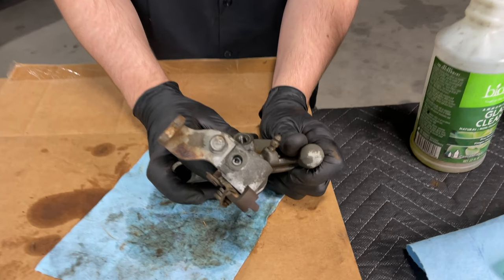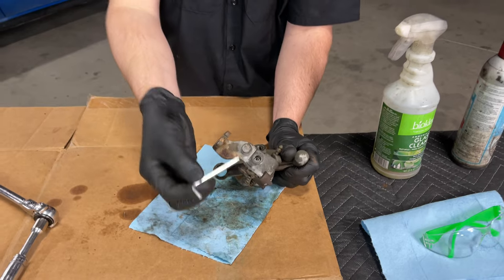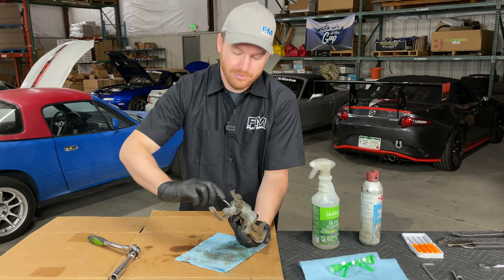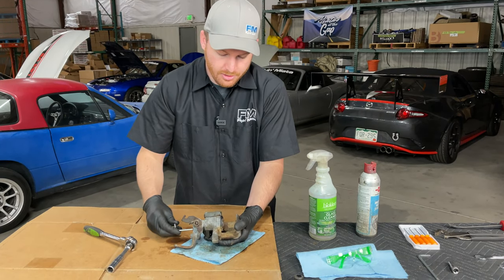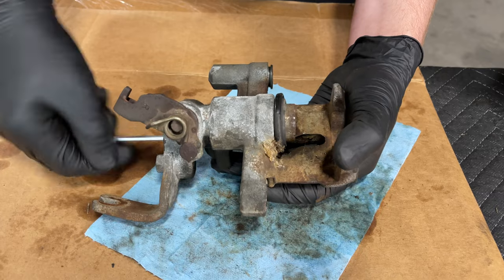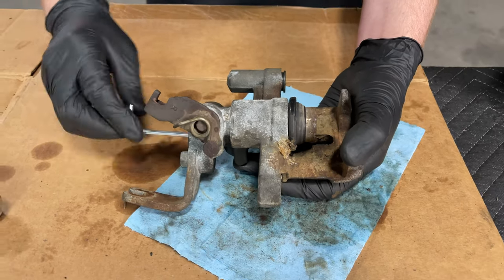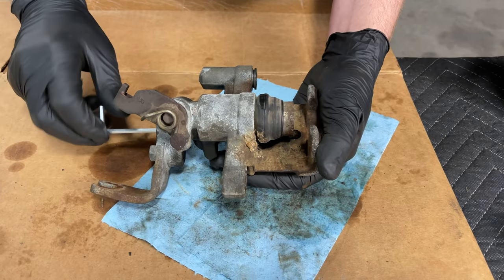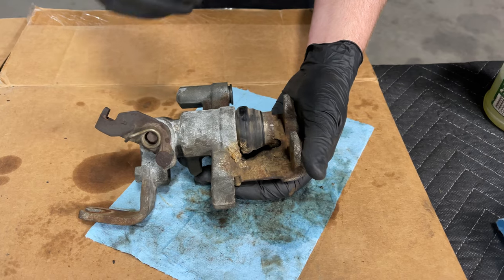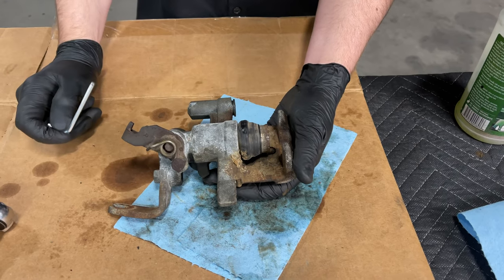Down inside there's a little adjuster with an Allen keyway. On this particular caliper the keyway is a 4mm. So I have my Allen wrench, and I'm going to manually use it in that little spline drive on the backside of the caliper to extend the piston. It does move slowly, but once you get it going you can see the piston extending because there is a threaded rod on the backside that's manually moving it out. Once you get it fully extended, you'll feel that the spline drive gets a little loose — that way you know you're at the end of travel.